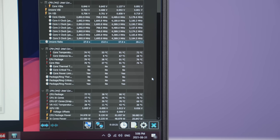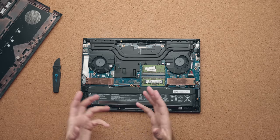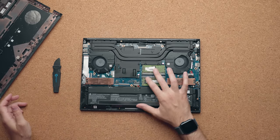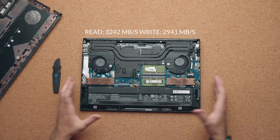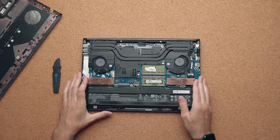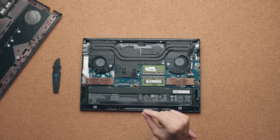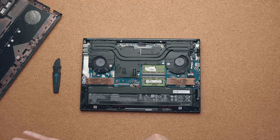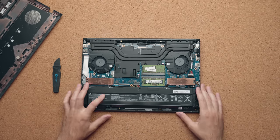Heat management on both the Victus and the Omen 15 is fantastic. The Omen 15 has bigger blades, slightly bigger fans, and one extra heat pipe below the left fan. RAM is upgradable on both up to 64 gigabytes, though the Omen uses rank 8 memory while the Victus uses rank 16. They both have two NVMe SSD slots, but the Victus uses an Intel CPU so you can install PCIe Gen 4 SSDs with faster read and write speeds. Battery size is identical at about 71 watt hours, but I got four and a half hours on the Victus compared to only three hours on the Omen, which is surprising given the Omen uses a Ryzen processor. The Omen has a soldered Wi-Fi card, whereas the Victus has a swappable one.